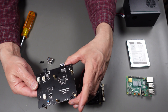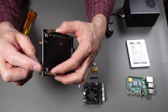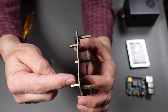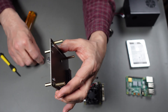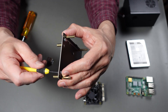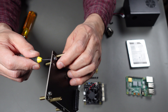All the standoffs are now on in the right place. Then we can put the hard drive in. Keep in mind with the hard drive there are little spacers embedded onto the board itself - the screw is going to go through that spacer first and it barely makes it into the hard drive. I suggest getting them started first until they just start to touch.